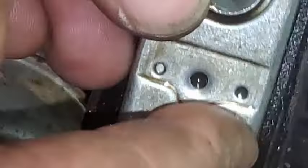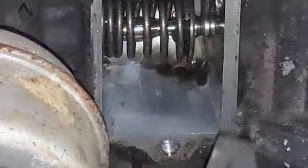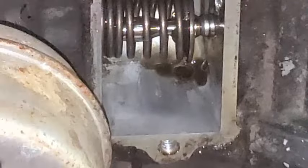See, this fills up. Starts getting filled up with oil. And then it will shoot out through here back to the carburetor. If this starts getting filled up, it's got nowhere to go, it'll shoot out back to the carburetor. It's supposed to be just unburned gases, like unburned emissions. It's emissions control kind of thing. Let's see. Yeah, this muffler's loose.